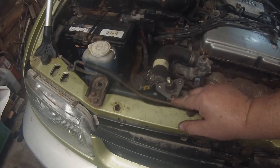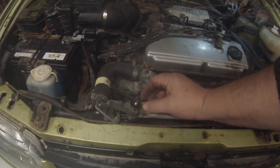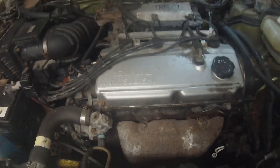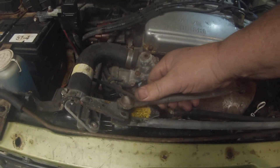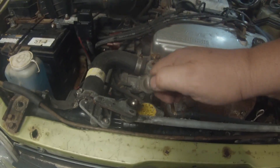Here's the bolt I snapped off, but there are two more holes so it should be fine. You can see where the other arm pushes on. If I can get that to snap back in, great. If not, I can replace the plastic bushing - I've got a kit for that somewhere. The other end goes onto the wiper motor down in here, which will be a little harder to get at. But that's what we're doing to get the wipers working.